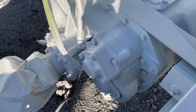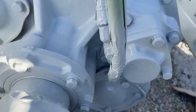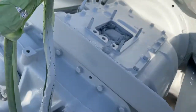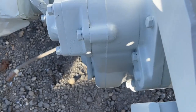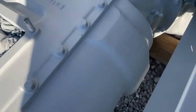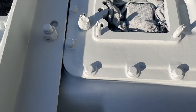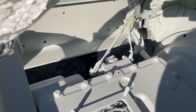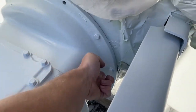so I'm gonna go ahead and mix up my base coat, and I'm gonna go around first, and I'm just gonna shoot it into nooks and crannies like that, and down in there, where my cup is, right there, anywhere where it's gonna be hard to get good coverage. And I'll just try to get just a dust coat on those areas and just skip everything else for a minute. Like, I'm gonna try to get the back bottom of these bolt heads. I'm gonna try to get good solid coverage, so my first little pass will just be to hit those areas and nothing else. I don't want to have a problem with light spots on the backside of bolts or on the bottom of bolts or whatever.